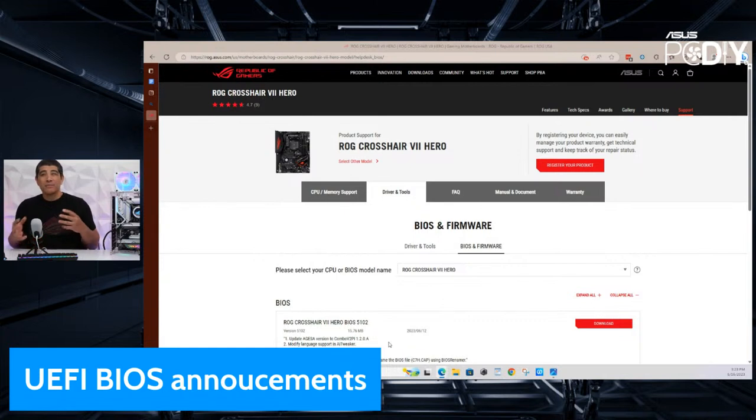Sometimes users just assume they can roll over their settings from one build to the other, and that's not actually going to be the case. If you're following pretty close to stock parameters, you can generally update without any concerns, but many users are running some form of overclocking, even on their memory, such as DOCP, or some form of PBO and customized power profiles, or maybe RAID. Even with RAID, there can be things like option ROMs that can be updated and affected by the UEFI releases. So do be mindful of that when you go about updating those UEFI builds, okay?